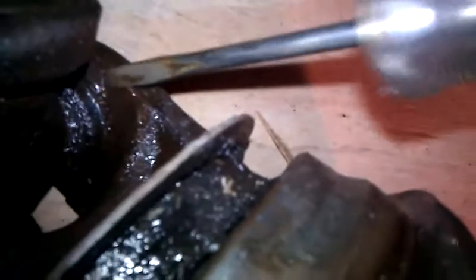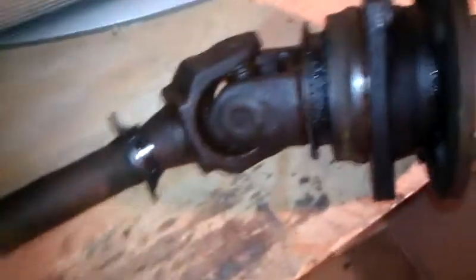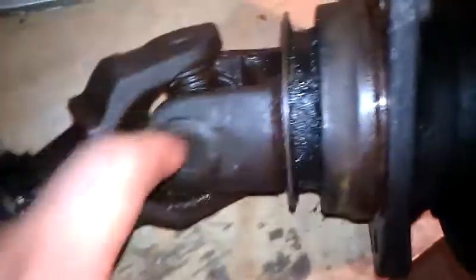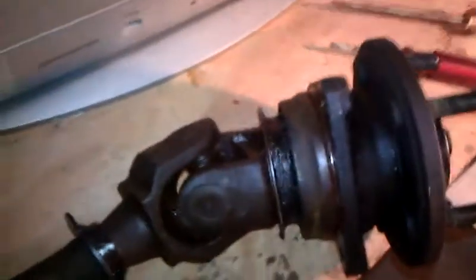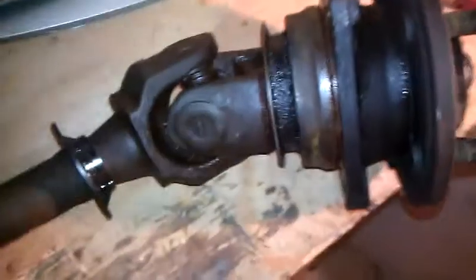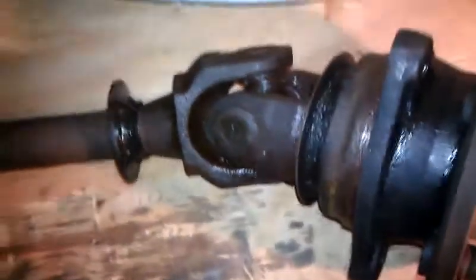The clip is right there, and you've got to beat them off to get the U-joint out. Once we do that, I'm going to get these caps off, and then we'll get it all out and put the new U-joint in and be ready to go.